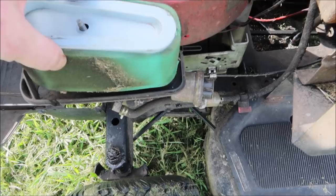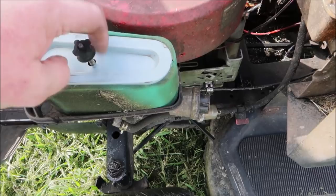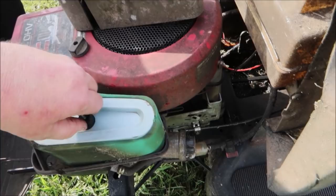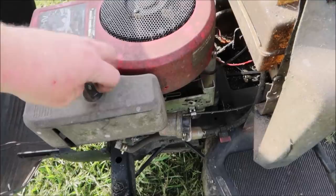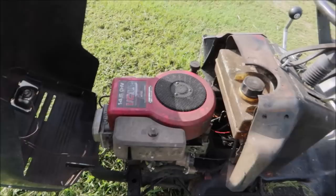What I'm talking about is dirt ingestion. If there's been dirt ingestion in the past, you won't always know, because if the customer is smart they will have already done a service before trying to sell it. But you can tell whether or not the engine is going to be healthy just by cranking it and looking for exhaust smoke. Blue smoke means it's burning oil. Black smoke means you have an issue with the fuel delivery system. White smoke on a Kawasaki liquid-cooled engine means you possibly have blown head gaskets or an intake gasket allowing coolant to be burned along with the fuel.